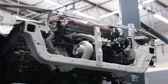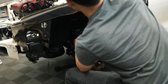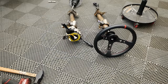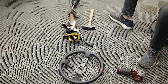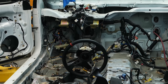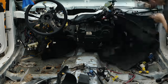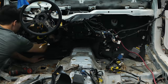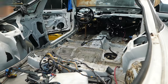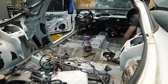We've hung the engine in the engine bay. Now the next priority for the build is getting it mobile so it can be rolled around the shop. With that in mind, I begin the process of swapping the Fortune Auto suspension and steering column over from the Eclipse. I'll need the steering column for its lock cylinder since neither of the keys I got with the Talon seemed to work with the Talon lock cylinder. I also want to start putting the heater core back in as soon as possible while the process of removing it is still fresh in my mind. And finally, I deep cleaned the bare interior of the Talon, cleaning and covering any small rust spots I found along the way.